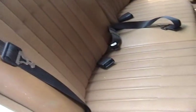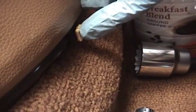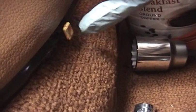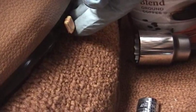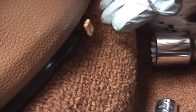This is actually really easy. The bottom part comes out without any tools. Here on the left and right sides, you push these in — it'll release the spring clip which will pop the front of the seat up a little bit, and then you just lift the front of the bottom of the seat out. So I'm gonna go ahead and do that.